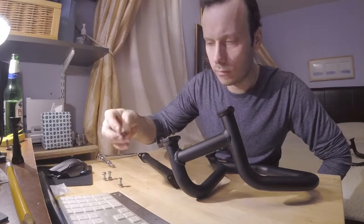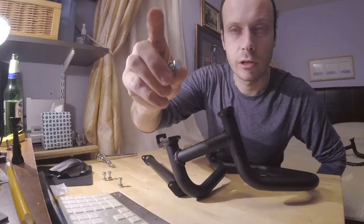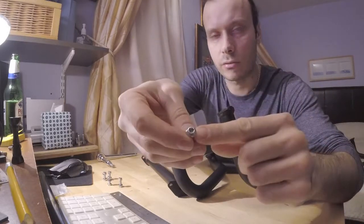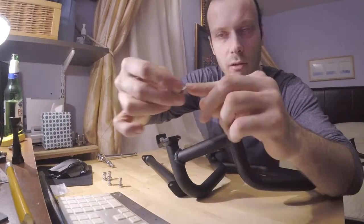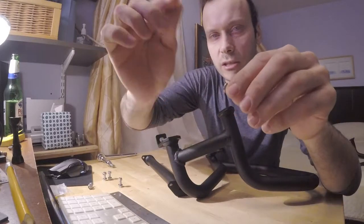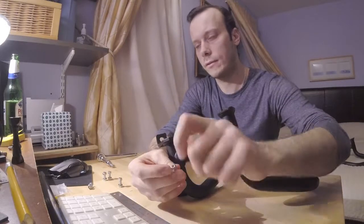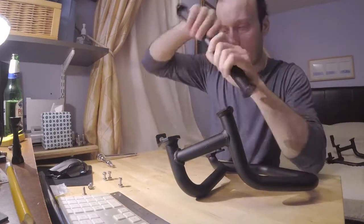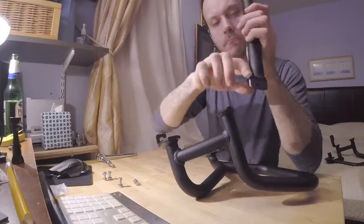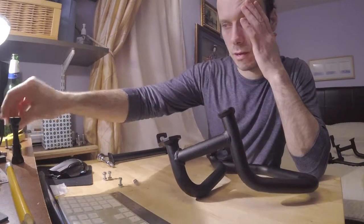Other companies provide thread lock and installation instructions. Outback could put a video online showing what tools you need and how to install them — it's 2018, everything is internet. Also, I switched to a ten millimeter wrench instead of the allen key because the allen key head can strip. When tightening toward the radiator side, there's very little room and you barely have any leverage.